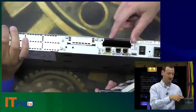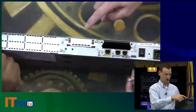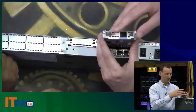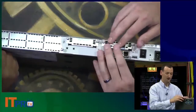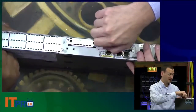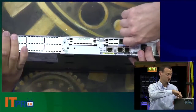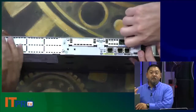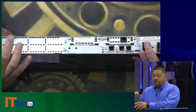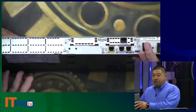If you don't need it, the router comes with a little blanking cover over the slot. If you need it, you buy the WIC and pop it in — now you can plug in a T1. If you're going to be doing DSL or whatever, you can get WICs for those, pop them in, and gain access to those ports. It makes the router highly configurable to meet whatever the needs are in your network.